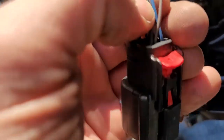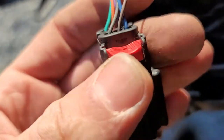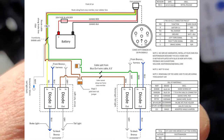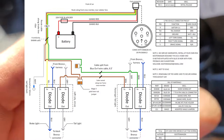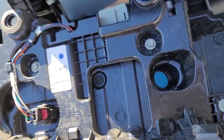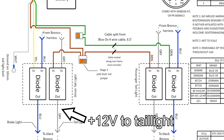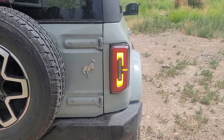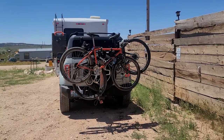The next step would ordinarily be a lot of fun, because you'd have to identify which wire does what, since the instructions don't go so far as to be specific for the Bronco. But I've already done this work, and here's the schematic for it — I'll also leave a link in the description. I disconnected the black 6-pin connector from the taillight assembly and probed each pin with a multimeter while my wife cycled through the brake lights and taillights. The gray wire is the positive 12-volt signal for the taillight, while the blue wire is the positive 12-volt signal for the brake light. Although the Bronco has a yellow turn signal, we will not be wiring to that — when turning, the taillight will be flashing rather than the yellow turn signal when being towed.